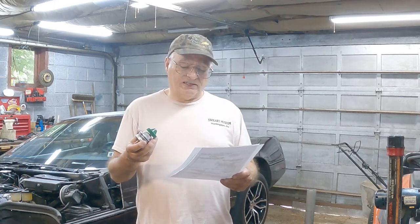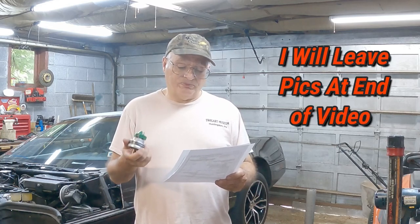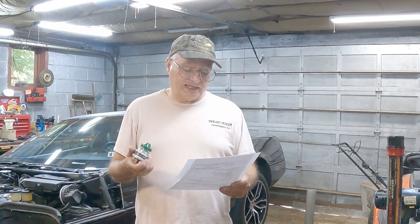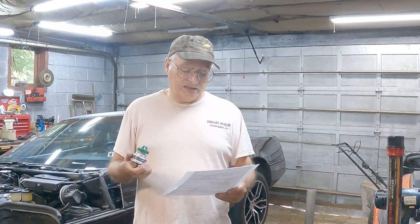Best thing to do is have the factory service manual. It tells you about how it operates. Basically, this is a permanent magnet — a PM generator — and it produces a pulsing voltage whenever vehicle speed is over 3 MPH. The AC voltage level and the number of pulses increases with vehicle speed. The ECM then converts the pulsing voltage to MPH, which can be displayed with a scan tool. The ECM supplies the signal to the central control module, which is sent to the LCD speedometer for operating the speedometer and odometer.